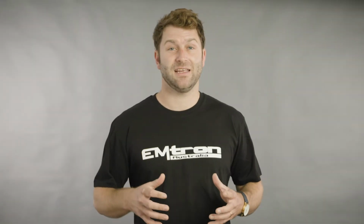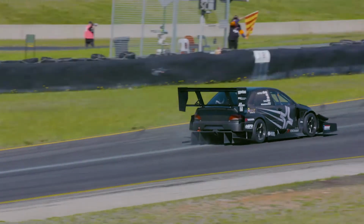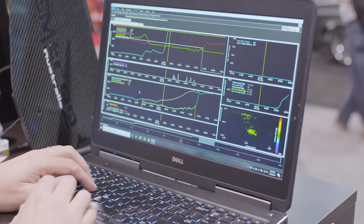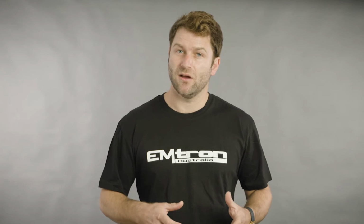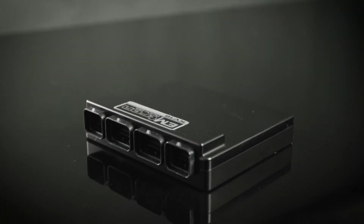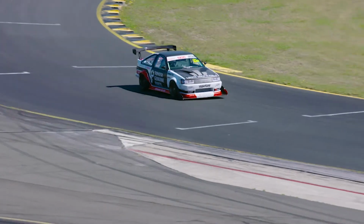The KV16 has 14 digital inputs providing frequency and switch-based inputs. These inputs have a high level of configurability, allowing easy interface for all sensor types. Digital inputs 1 to 8 can be used to measure frequency, while all channels can accept a switched input. Digital inputs 1 to 4 can be used for reading camshaft angle for VVT control.